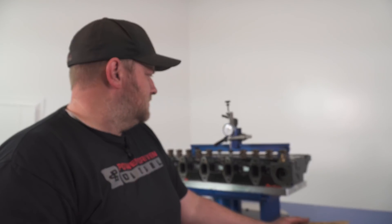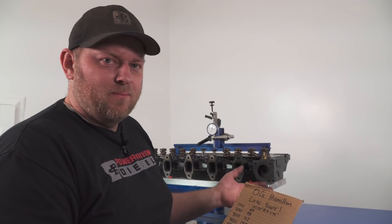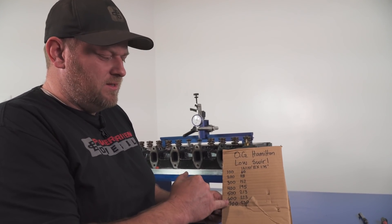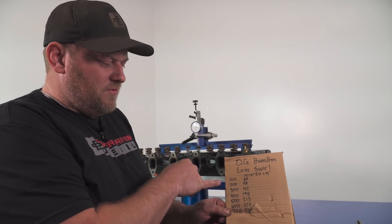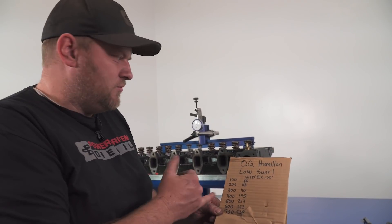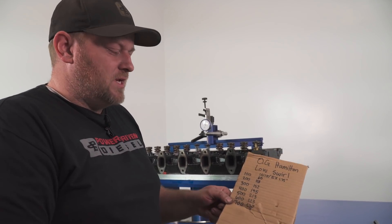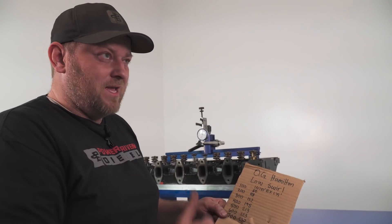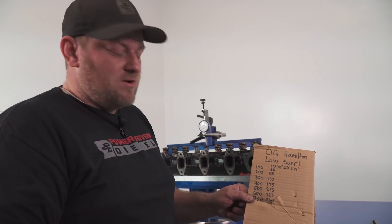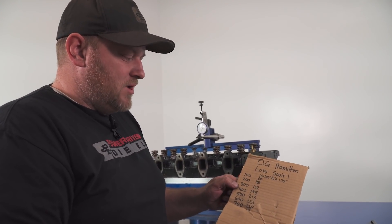What's interesting is that when Hamilton designed this, it's a race head for a big cam. With a factory cam you don't even get into the 500, 600, and 700 lift range at all, so all those numbers are somewhat pointless. Really all you're focusing on is the 1 to 400 range. Stock cam barely lifts over 400 — about 450 thousandths depending on whether you're a 12-valve or 24-valve. Still, 195 CFM at 400 lift is huge. The last factory head we flowed peaked out at about 132 CFM at 300 to 400 lift and didn't gain any more. So this is a pretty big upgrade over stock.